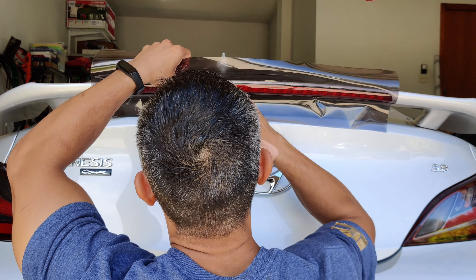I was pretty comfortable with the way everything looked, so I'm starting to do the cut. This is an easy cut — just be careful because I'm using a knife. There's a gap between the brake light housing and the spoiler itself, so just put the tip of your knife in that gap and then use the spoiler and the brake light housing as your guides. You can just float that blade right in that gap.